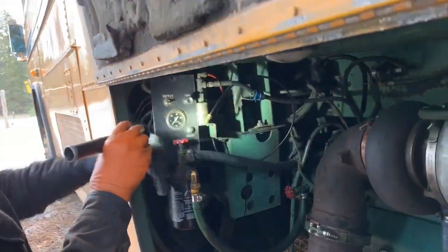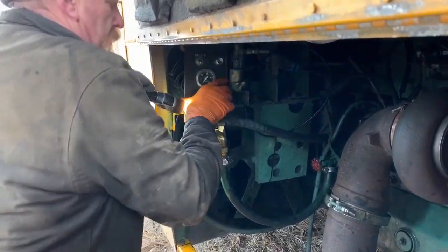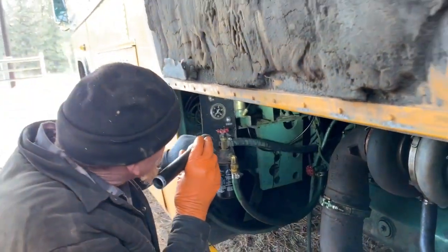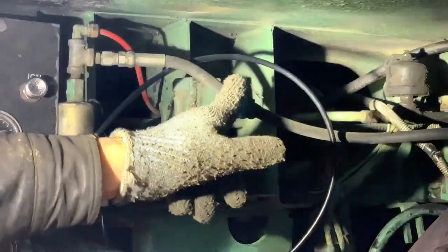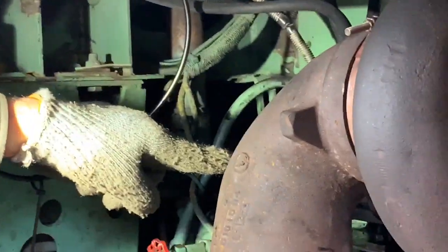You shut that off and there's no start button. So, what's that sound? That's the air leak we've been talking about, from that device he showed us. This air line is air coming in, mounted right behind each other. This line is the line going to the valve that's causing it to leak. This line is going to that shutoff solenoid.